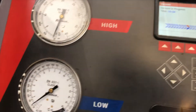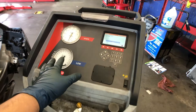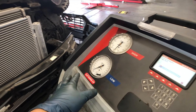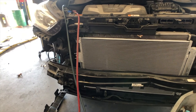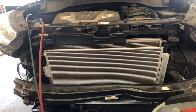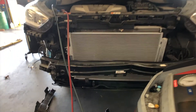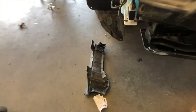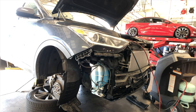The system is going into vacuum. It's supposed to be 30 to 45 minutes, but there's no time for that. Honestly, with 20 minutes of vacuum this car shouldn't have any problems — I always do it this way and never have issues. If you do it differently, let me know in the comments if 25, 30, or 40 minutes actually makes a difference. We've also got a new dryer so that shouldn't be a problem. Oh — I forgot to put those air deflectors back on, so that brace is coming back off.